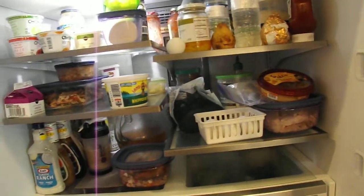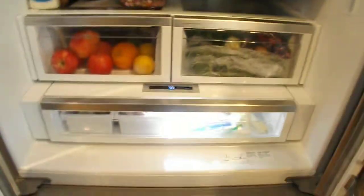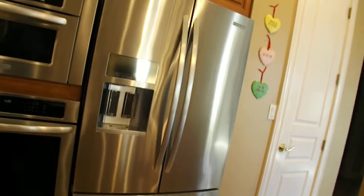There is an LED driver in the back, just below the main control board. That LED driver sends the voltage out in three different sections: one section is two lights in the ceiling, another section is the side lights, and then there's another section that's three lights in the ceiling and the freezer together. So these are all in series — three different series of lights.